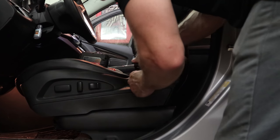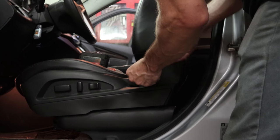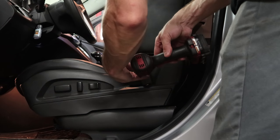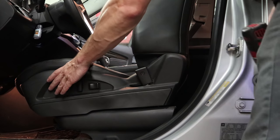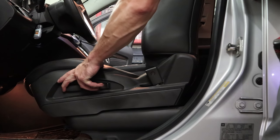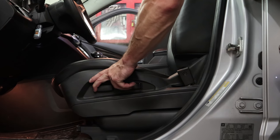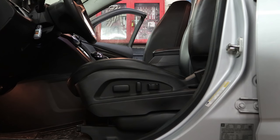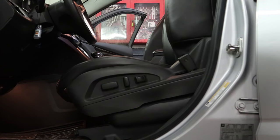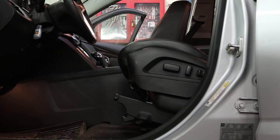This is something I always forget: when you're pulling the interior out before you pull the motor out, you want to disconnect the seats. They're power seats and you have to slide them all the way forward to unbolt them, so it's a lot easier to do it now when the car has battery power. If you drop the drivetrain and then later decide you need to pull the interior, you have to hotwire the seats. It adds a few minutes of labor, so it's easier just to do it now. It's only two bolts in the back and one for the seatbelt, then one plug underneath. Did that on both sides.